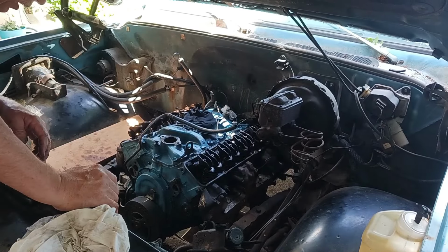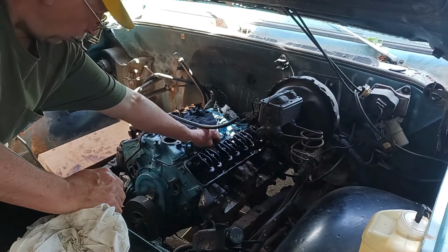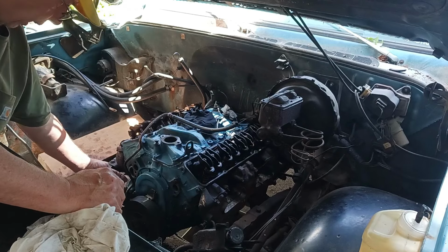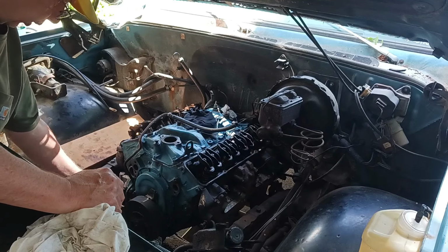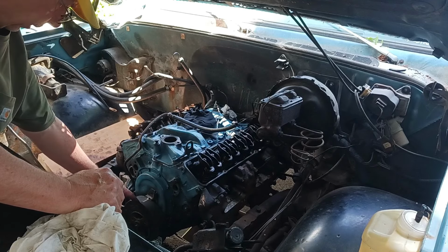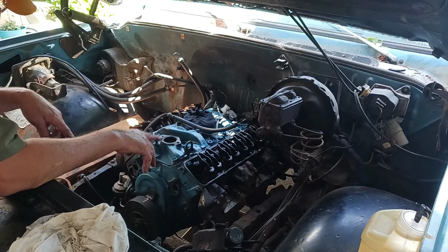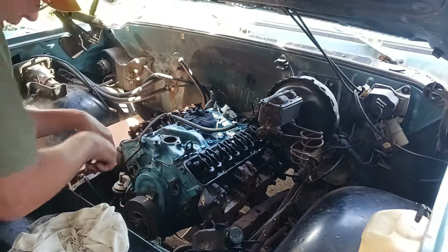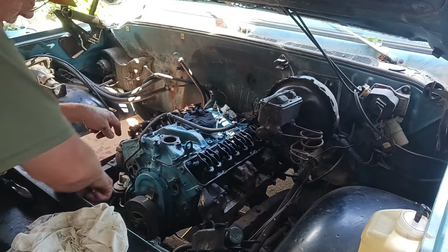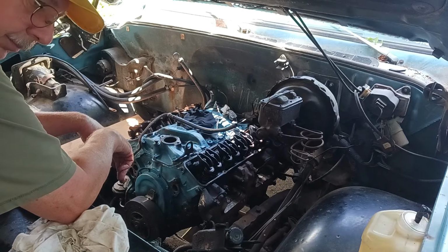All right, show you more. Well, Eric stopped by. He's down underneath draining the oil out and trying to get the oil filter off. And I've got all these snugged up, every one of them through here. Now, I got the fuel pump back in so I can release the fuel rod against the camshaft. So let's rotate this thing. The plugs are out of it, by the way. But I want to verify first, I'm kind of like Reagan. He was the man I voted for the first time I ever voted. So let's verify that we are up on top dead center. And then we're going to rotate this around and watch these and make sure they're going up and down. So that's the plan.